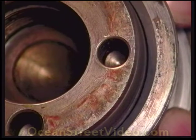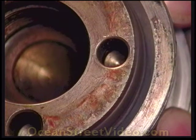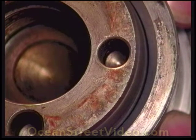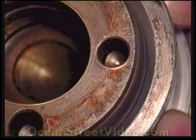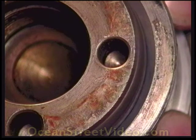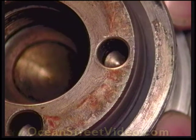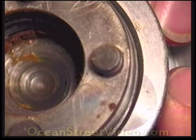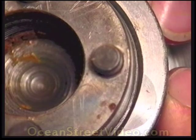This is the heel of the crank showing the clearance of the rear main bearing. This crank has been turned to 20 thousandths under, while the bearing is for a crank that is only 10 thousandths under — this creates too much free play. To avoid this, get your bearings from the same place that does your machine work and don't rush your engine assembly. Here is the correct rear main bearing for this crank; the fit is quite a bit tighter.